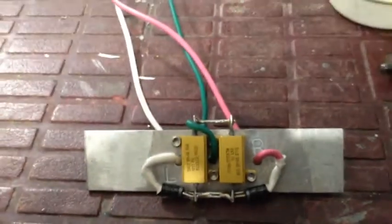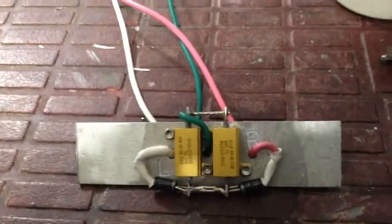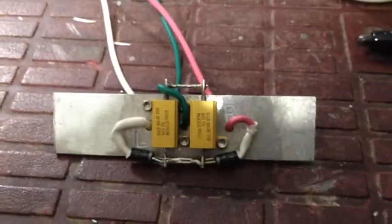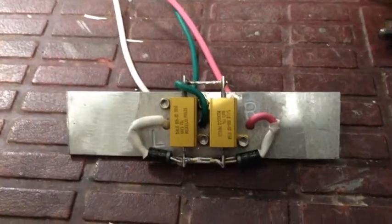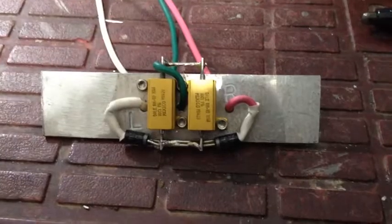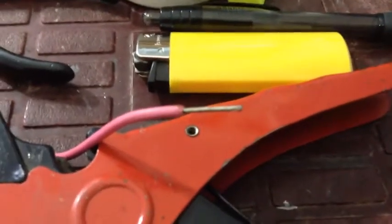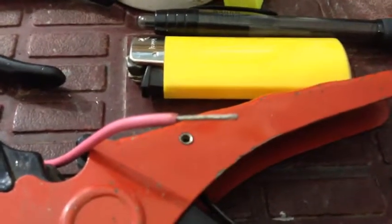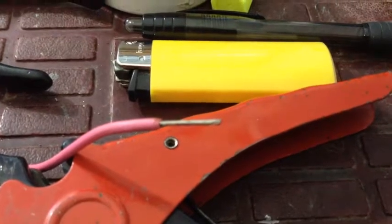I've run the green wire, which will be the ground side of this circuit. That green wire you can attach to anywhere on the motorcycle — the engine, the frame. If you decide to drill this aluminum plate and attach it somewhere else, as long as the bolt you're using is going to ground, you can put a ring terminal on it and ground it that way. I strip back some of the insulation off the wire going to the right turn signal termination and solder the wire so it becomes stiff and won't spread out.